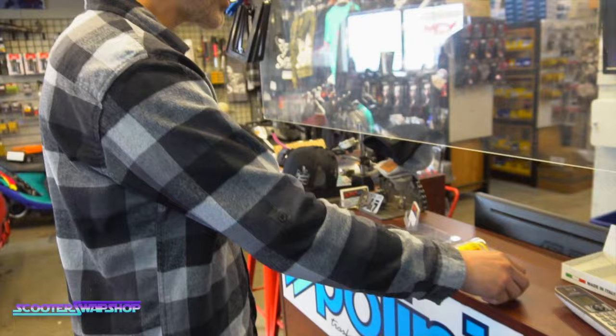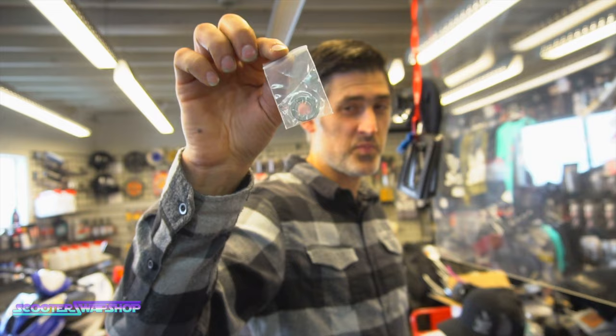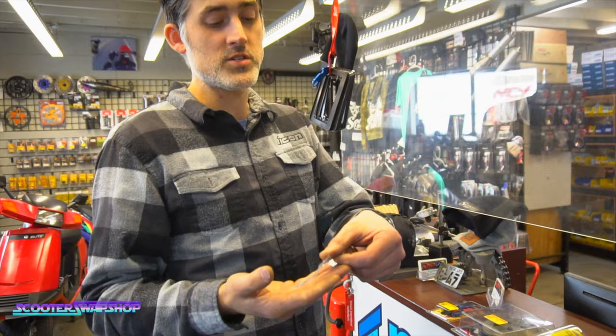So these guys are cheap, but this is probably the best gain to be had for the money. I don't know how many shim kits we sell a year, probably 1,000. But I would say, any bike you're doing, these are necessary on every single one. Also, if you put in a new belt and you have, let's say, 2 or 3 shims in it, as your belt wears you need to remove these shims at the same time, because your belt's getting narrower, so you take these shims out. So this will also allow you to get more performance out of your old belt.